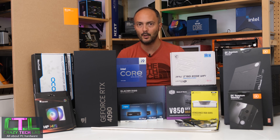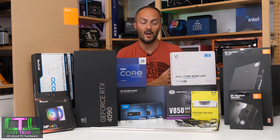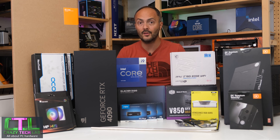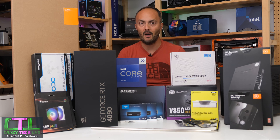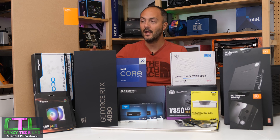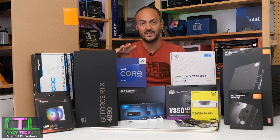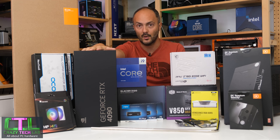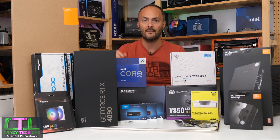What we wanted to achieve is building the most insane mini-ITX PC in a very small space — one that's great at showcasing the hardware inside. I had free range of all the components other than the processor, and if I was going for a super high-end PC the 13900K would be on my short list anyway. We have a full water cooling system here that's going to be cooling the CPU and our graphics card of choice, which is an RTX 4090 — by far and away the most powerful graphics card out there right now.